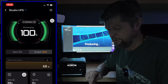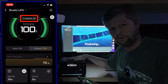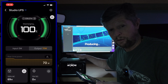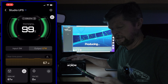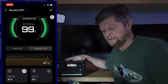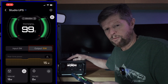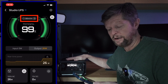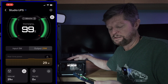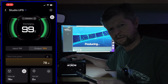Looking at the app, you can see it is telling me — based on the current draw — that I've got around about four hours before I'm out of power on the River 3 Plus. For this particular project, that's more than enough. But let's say this was a longer project, maybe an upload of a very large video. In that case, what I might want to do is actually turn off the monitor. When I turn off the monitor, you can see it's drawing now just around about 15 watts. We have a lot more time available at the current draw, and any time I want to check on the progress I can simply power on my monitor and see the wattage increase. I have more than enough power available for this process to complete and shut down the computer.